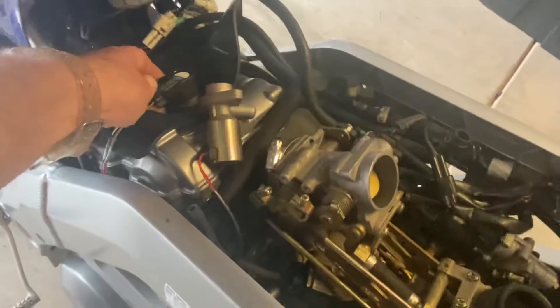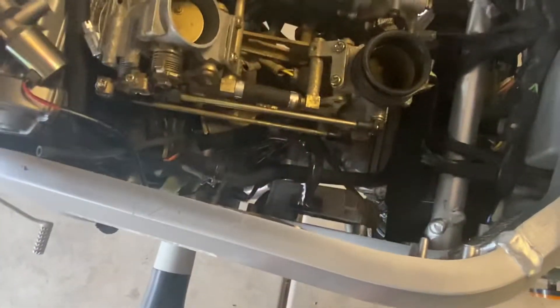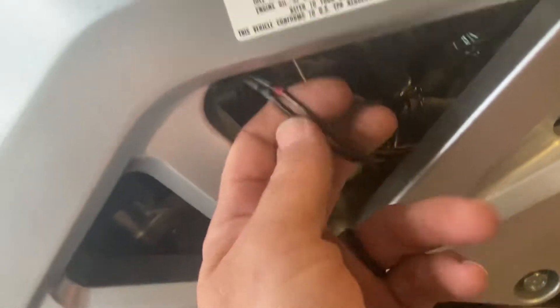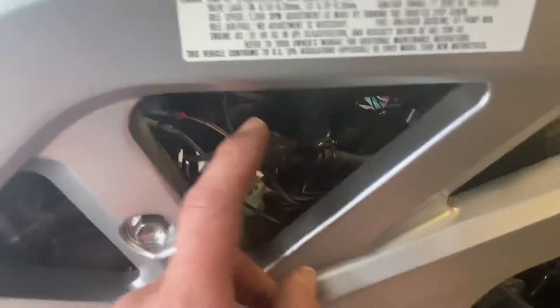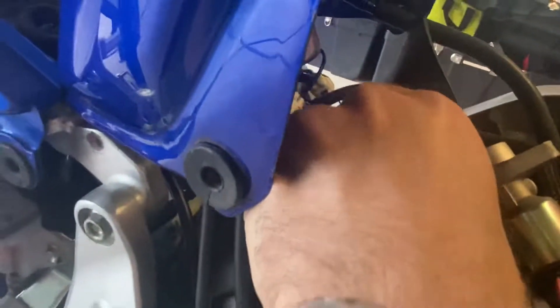You will have to extend the wiring. On the rear cylinder your factory coil is mounted on the right side of the bike, and you're going to have two wires — one's gonna be orange and black and the other one's gonna be all black. The way the coil packs work on these bikes, as soon as you turn the key on and hit the red button they get 12 volts directly, so the rear cylinder gets 12 volts from the orange and black. When you buy your coil packs you're also going to need the pigtails — the lead on the right is the positive and the lead on the left is the negative.